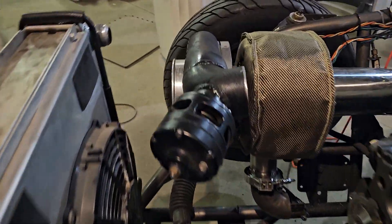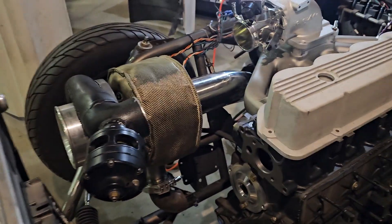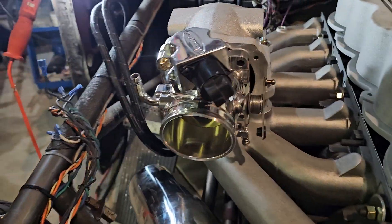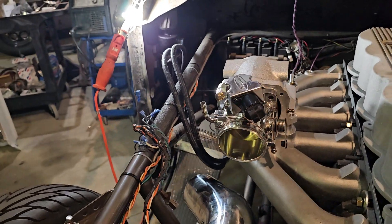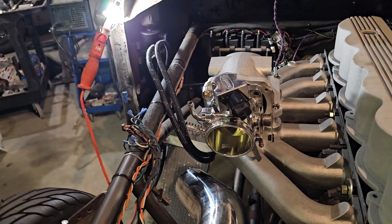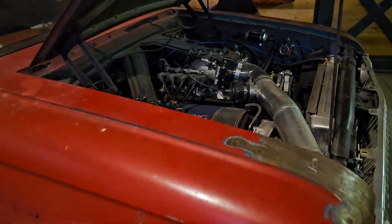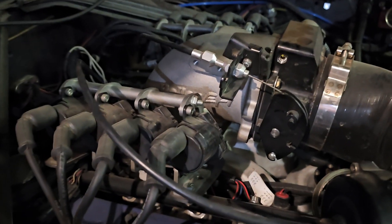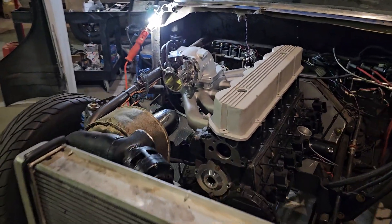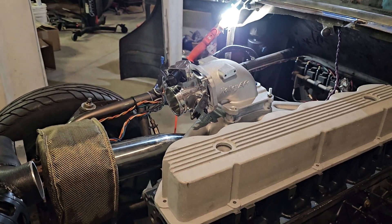On the cold side it had another tube on there. The previous setup went straight to the throttle body, but this one is a little bit more offset. I have to build a little bit of an adapter plate — a Ford 5.0 throttle body onto this LS elbow. I should have got the Ford elbow. What we'll probably actually do is swap — over in this little Falcon it has the Ford elbow with the LS throttle body, and over here I've got an LS elbow with a Ford throttle body, so we'll swap those around.